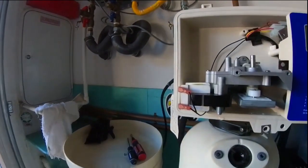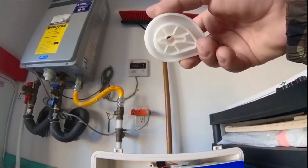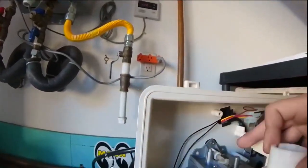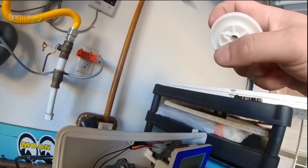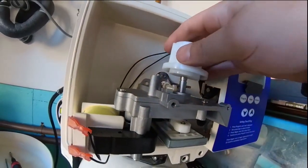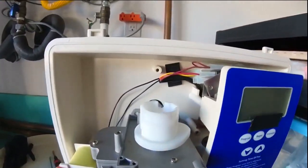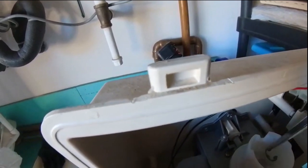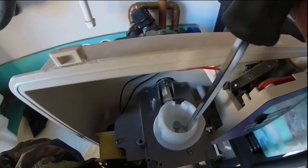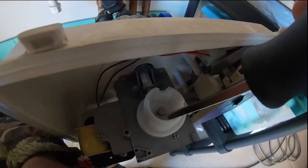Next, line up the cam and install it. There's a longer side and a shorter side here — if you look at the cam, there's also a shorter and a longer side. The round notch on the brine piston that I mentioned earlier is going to go in the outside groove here. Make sure it's in the groove. Everything looks good — take your flathead screwdriver and get this locking ring, then lock it into place.